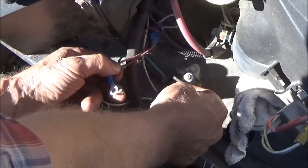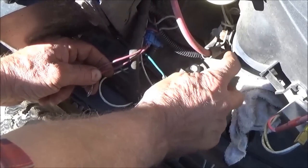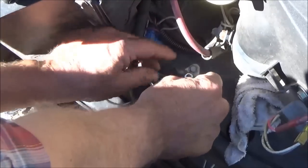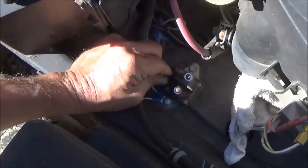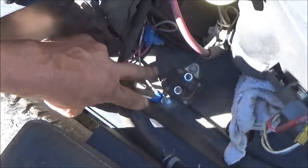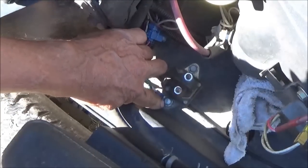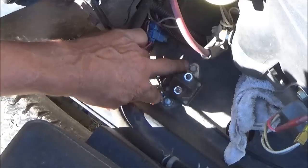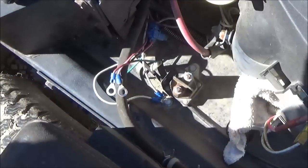These two wires go on the same side where the battery cable was. The starter cable was on this side — the way I'm remembering that, the starter is on this side also. And then I got an energized wire down here that energizes the solenoid — we're pulling that off. There's two ground wires down here. I don't know what they go to and I don't care. They're white and they're grounded on these screw bolts where the solenoid is mounted at, so we'll put them back there.